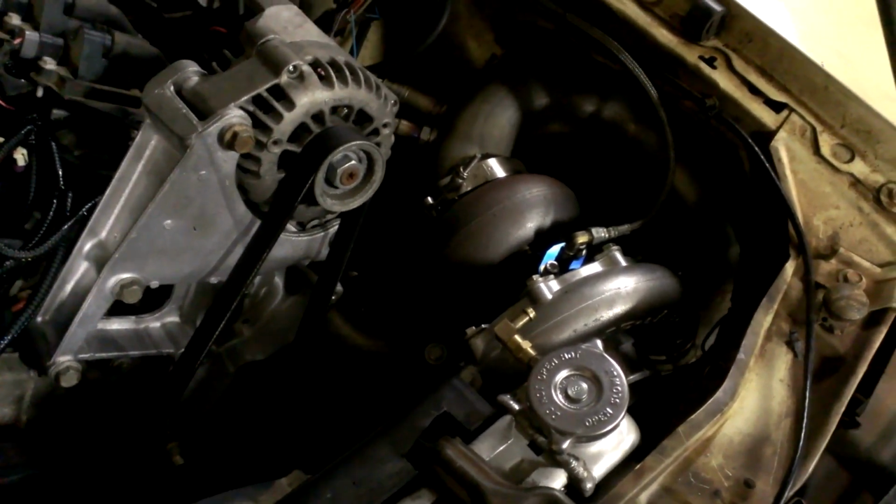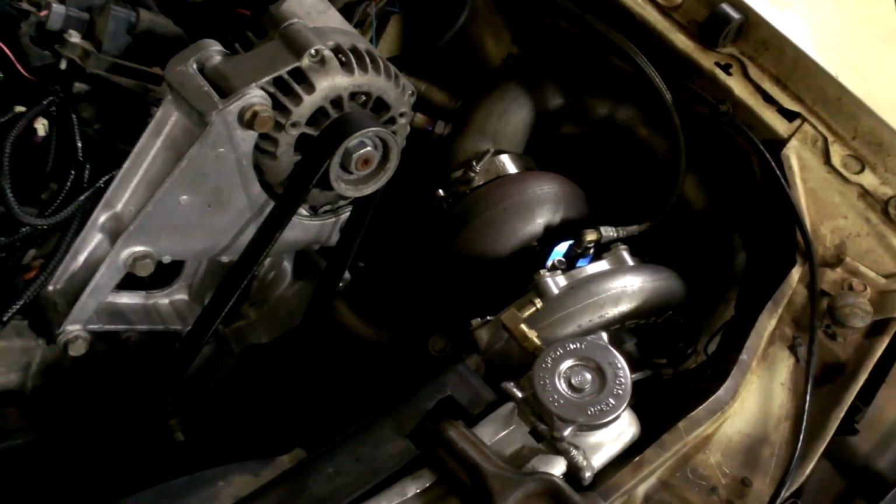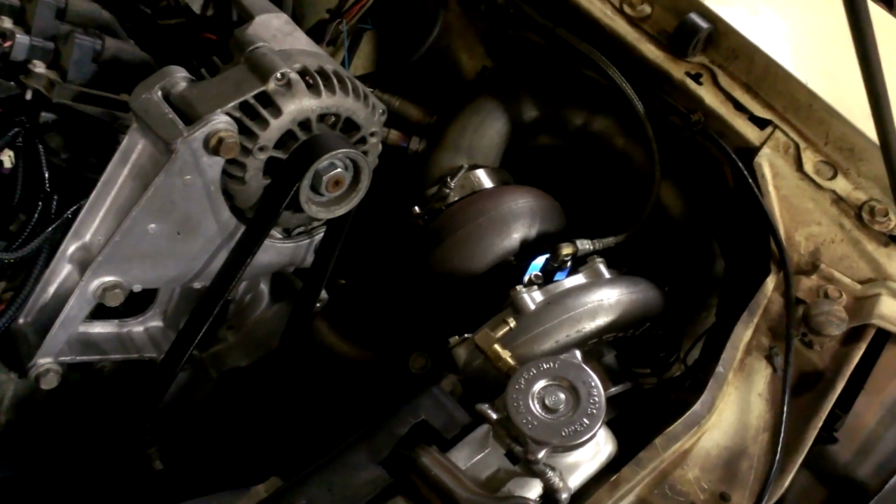And then the downpipe for a GT45 is a pain in the ass, because it's a non-standard 3-point whatever, not even anything normal. It sucks. So I just got a regular 3-inch V-band. While it doesn't fit perfectly, it fits fine and doesn't leak a drop with some no-name 3-incher on there. It didn't even come with the turbo, so that is all nice. Other than that, everything's been working great.